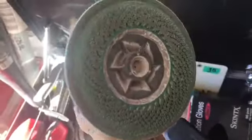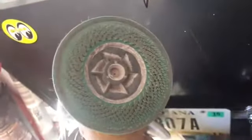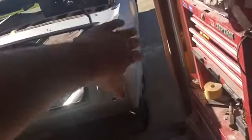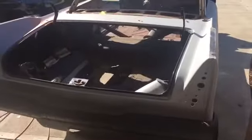I've been using 3M bristle discs — I used them on the Model A and this one's worn down to nothing. They're not cheap, but they strip really well. However, if you go across an edge they'll mess the bristles up and take them right off. You really just use them for flat surfaces. I'll use it on the side here but if I get up on that edge it'll start messing the bristles up, so I'll stick to the big open areas like the roof.